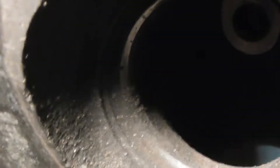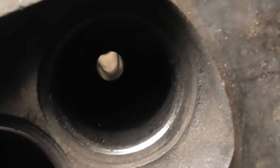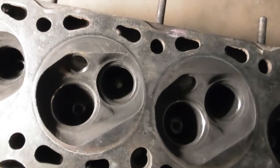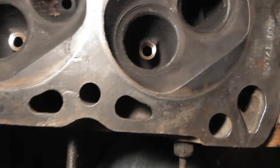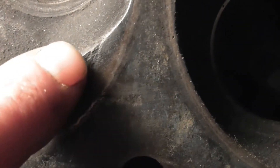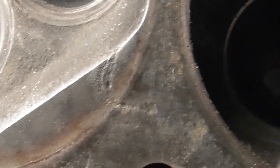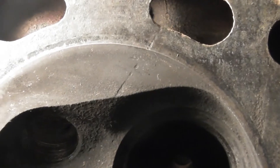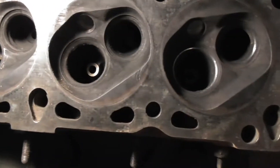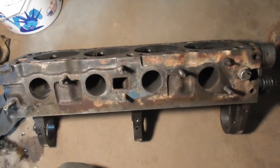There you can see some casting hanging off an exhaust. I believe he said he did this back in the 90s, probably the mid 90s — I don't know how much it was ran, but it's no good. There's also some weird stuff going on in the deck. My engine is turbocharged — to me, maybe it was detonating or running lean, looks like maybe it was eating the trail across the deck. Might just be a scratch, but anyways, this cylinder head is junk — iron for the iron pile.